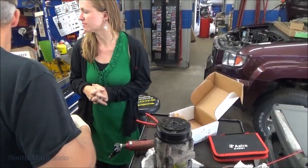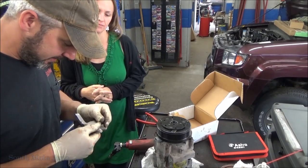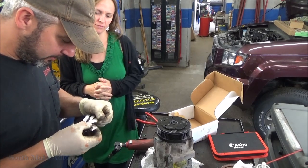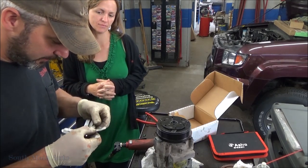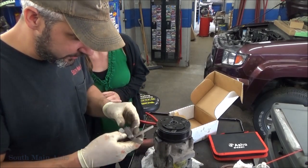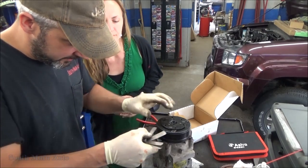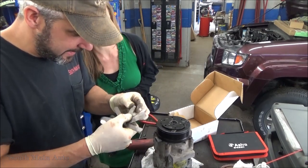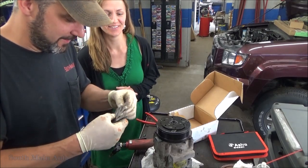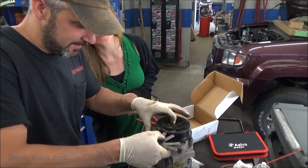0.35, 0.75 mm it says. So we need to find a 0.35 mm, so that's 14 thousandths, 14, 15, somewhere in there. Let's see what we got. Loosey goosey, so that's 0.381. Let's see where she falls here. There's two of them. Yeah, two of them. Hey, easy now, don't be saying anything like that. There we go. That's what I knew, there was two. I was doing a double stack measurement. Everybody does that.